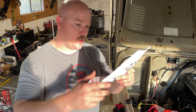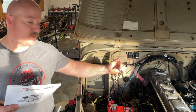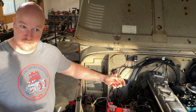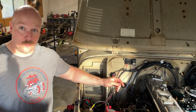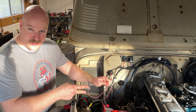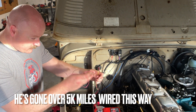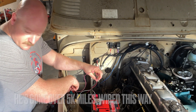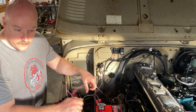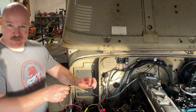The yellow wire goes to the coil. The pink wire goes to ignition — somebody mentioned I should put it on the ignition instead, but GA Architect from 'I Hate Mud' told me to use the FJ60 electronic distributor and coil per his instructions, which I trust. If I wire the ignition to the positive on the coil, it's going to be the same as if I were to wire it to the ignition hot. So we'll see — if it doesn't work, I'll have to redo it.